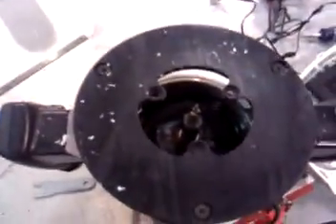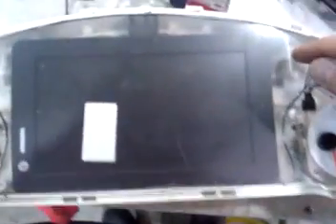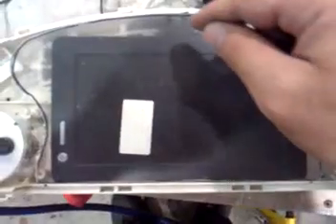I have my plexiglass cut out to where it will fit. Now I want to do an outline of my screen, because that's the part of the plexiglass that won't get painted. Then I'll figure out exactly where to put my stickers for my dummy lights. The only ones I really need on this instrument panel are my blinkers and my check engine light. You can tell from underneath the plexiglass you still have access to those lights. I'll also show you later how to cut little tubes out of foam, paint them white, and they will reflect the light straight through the dummy lights.